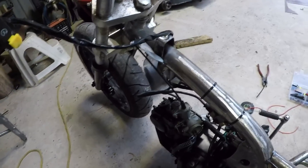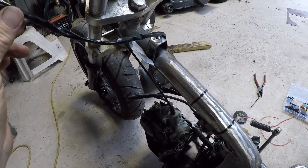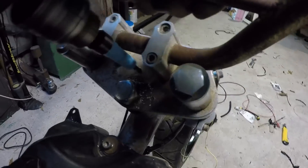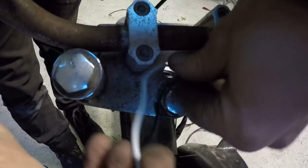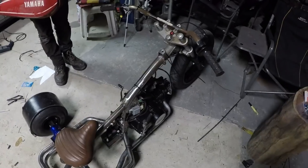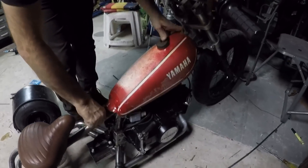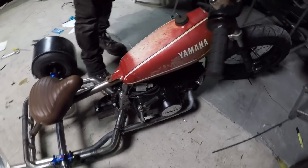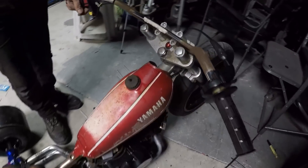The other thing I've done — in this engine there's actually a neutral signal, so I'm drilling a hole here in the top of the forks and putting in this light, wired so that when it's in neutral the light will come on. Here's a look at the tank — I think it's going to look awesome. I really like the front; I'm not 100% sure on that seat, so we'll have a look at that next time. There's the neutral light. Next video I will finish off the exhaust — stay tuned.